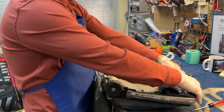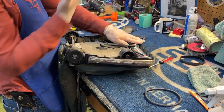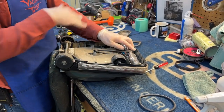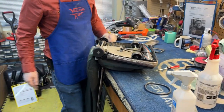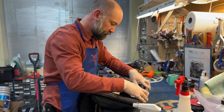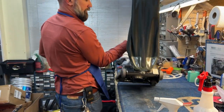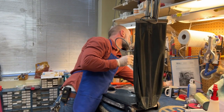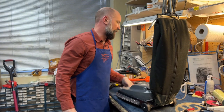After you get it on, I always roll the brush roller toward the back of the machine by hand. Make sure the belt is well set and not off to the side — it'll kind of roll itself in there. I always do that before I turn the machine on to make sure everything's set. I'll snap this back on — let's test it real quick. Rockin' and rollin'!